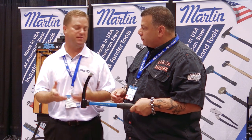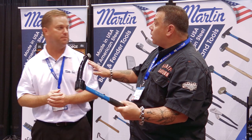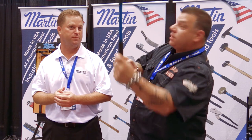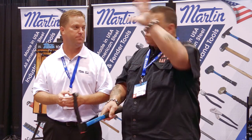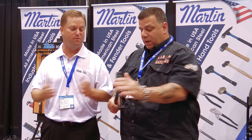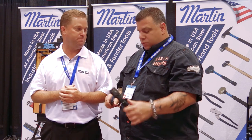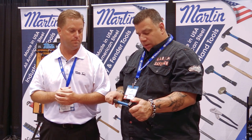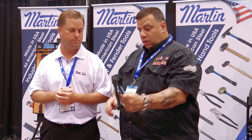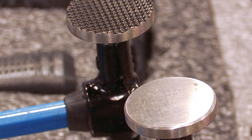Basically it's called the fender bumper. It's for working on fenders, reaching up into fender panels. So if you want to come underneath, like doing a bedside, you want to get underneath and up because you've got a big wheel well opening area. It's for major pushing. You can also hit with this side — you get a nice round edge that's kind of dead. Or if you need a smaller area behind something, you can use it as a dolly also.